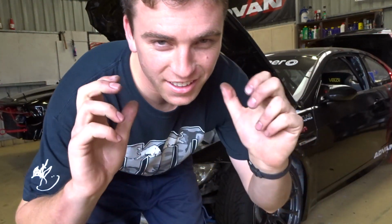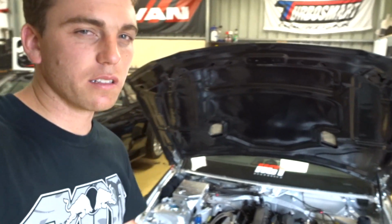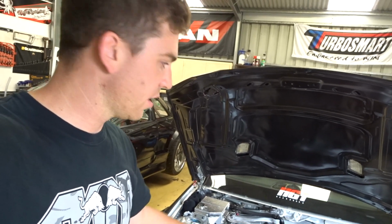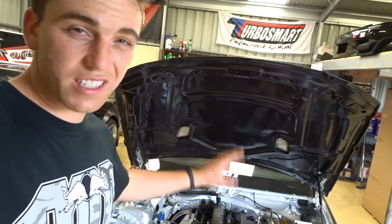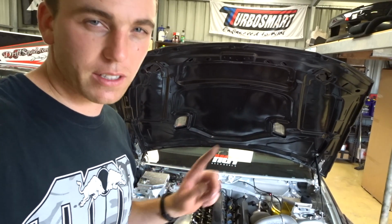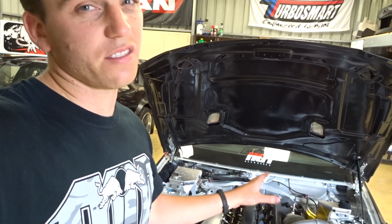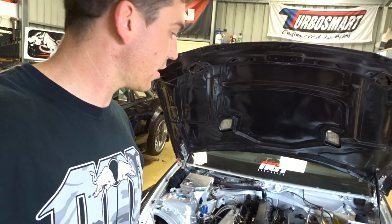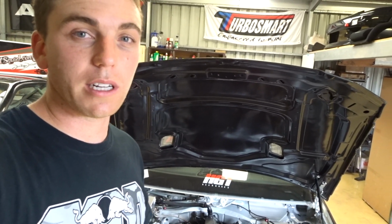Success. Okay. Now I'm just going to bleed it up, and we're good to go to the dyno. That's it. If the timing belt was too tight, then you would have heard it whining, and you could hear it whistling. The turbo is ridiculously loud, and the rear housing is actually in a bad way at the moment. The rear fins on the rear housing, so that's why it's extra loud. So I'm really going to look at maybe going Borg Warner next. Don't know yet. We'll have to wait and find out.